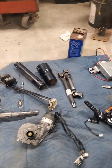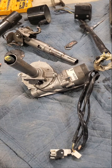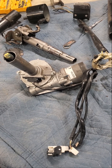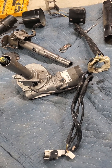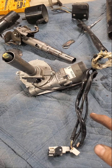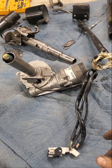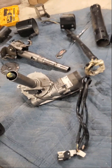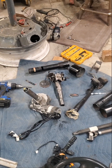Instead of that, I went down the YouTube rabbit hole of electronic power assist. There's a guy on YouTube - I think he calls himself the Ranger Station, or at least that's the website where I found his breakdown - saying that a Toyota Corolla 2010, or a Prius, Yaris, Nissan Cube, and a few others have electronic power assist steering that runs in limp mode. The limp mode is apparently a pretty viable solution with a very comfortable feel for steering, and if for some reason you lost power for the electronic power assist, you would still have manual steering.